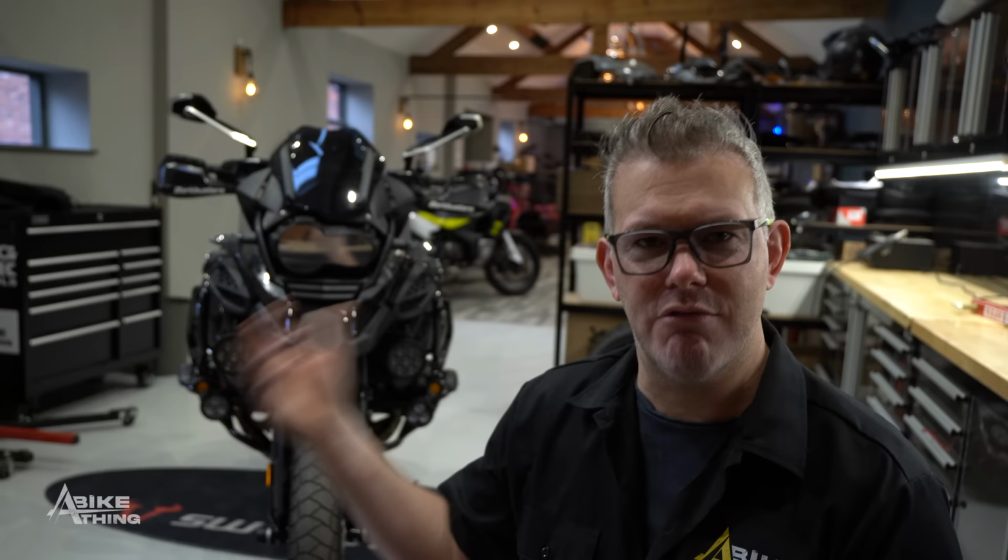If we get really technical, we can split the rear from the front. We could put the front lights on a light pair circuit, and we could actually get these front lights strobing if we really wanted them to, but I'm not interested in doing that. We just need to get these as clear turn signals.